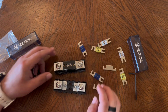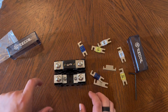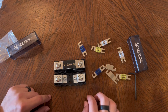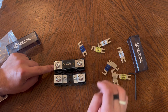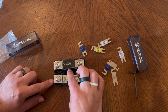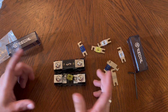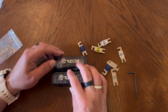The fuse I got in there now. Then connect it, because I'm going to be running both wires together. They're going to the firewall near the same area. But one's a 1 aught, one's a 4 gauge. So the 1 aught be coming in here, fused, coming out. Then what I'm going to do here is 4 gauge coming in, fused, Mini-ANL fuse, 4 gauge coming out. And then I'm going to put the covers over it, and that's that.